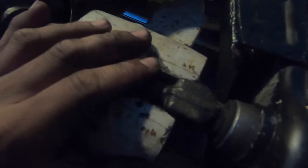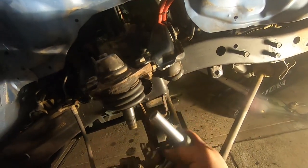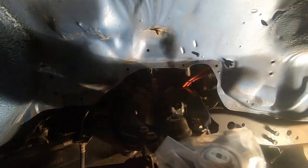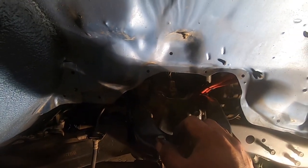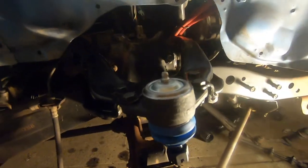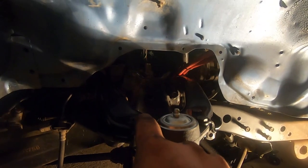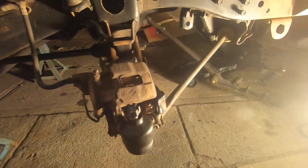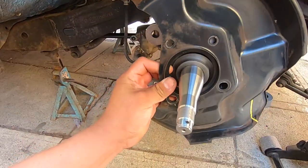We just went ahead and threw on the control arm. Now we're gonna remove the upper ball joint — these are 12 millimeters, we'll use a wrench and socket. We're not doing the flip thing where you put it on top — we're going to leave it like this. Later if we have camber issues we'll flip it. The new ball joint comes with bolts and nuts — the old ones were 12 millimeters, these are 13, and the little grease nipple is 8 millimeter. We got them all tightened up.